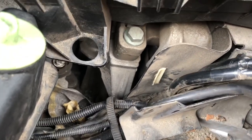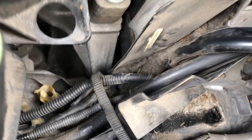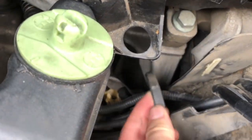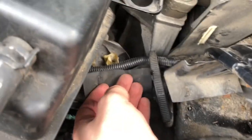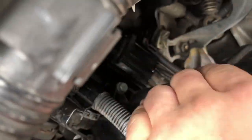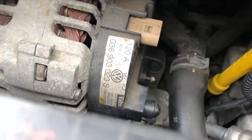I've already taken my alternator cable out — it's a very tough job to film. It runs down here, and there's a special harness with two zip ties that connects it all. Then there's another clip, and it runs under these two hoses and comes through the front straight to the alternator.